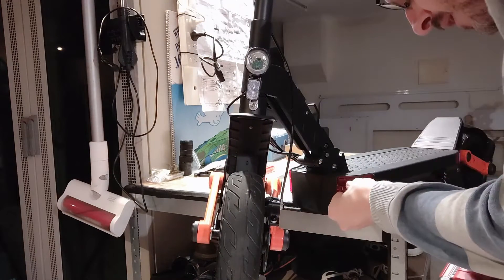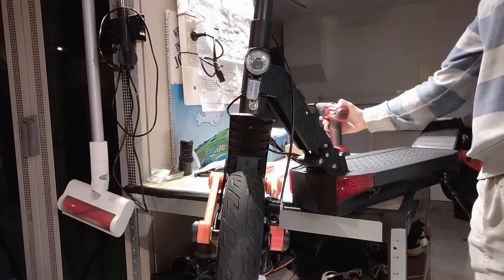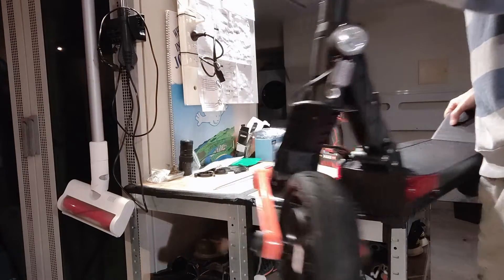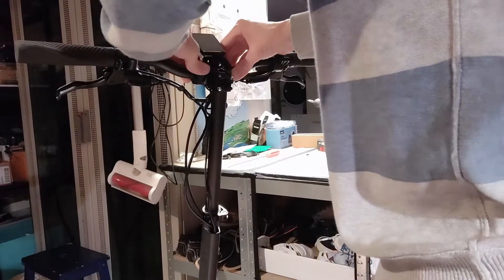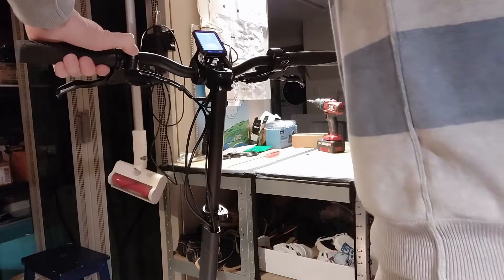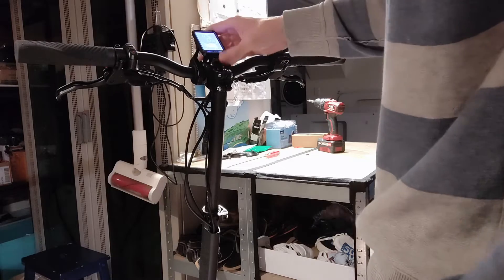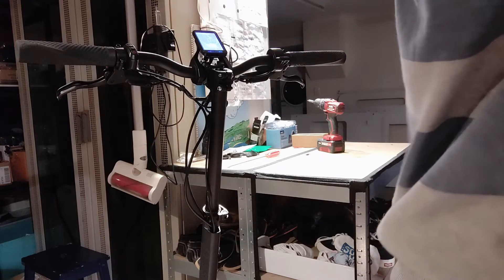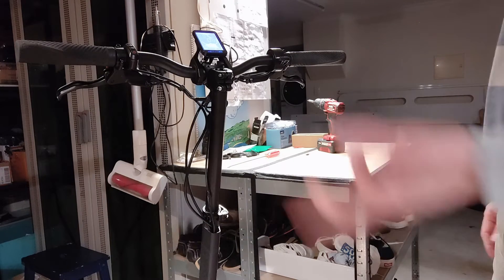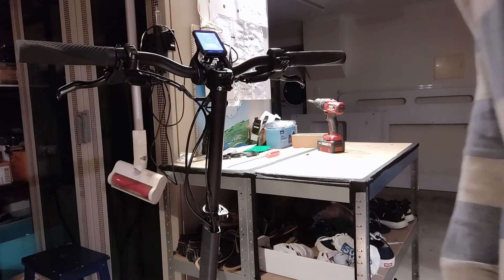So that's us in there all together. We'll just bring it down off the bench, and you can see now that you've got your power coming through — we're all ready to go. I'll just show you how the immobiliser works in the software. You can see it's thrown up there at this stage, which indicates it's currently immobilised. So I'll start the software now and disable the immobiliser.